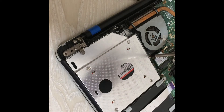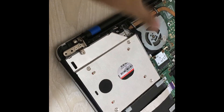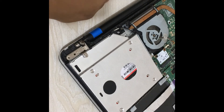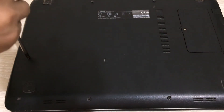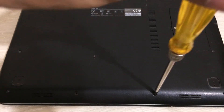I have only one screw here — it will vary from laptop model to model. Make sure you screw it so it doesn't wobble. You will also find an extra plastic portion in your CD-ROM; remove it and add it to your caddy so your laptop looks exactly the same from the outside. I've done that, and now I'll screw the back plate of my laptop — our physical installation is done.